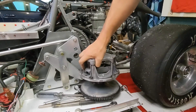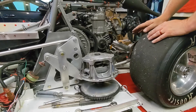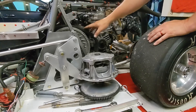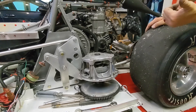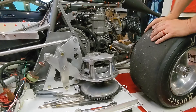So that's removing the primary. Removing the secondary is different on all cars — I'm going to leave mine on. You're just going to have to look at how your car is assembled; usually it's sliding the jackshaft out of the way and then the secondary comes out. I actually have another secondary I'm going to use for demonstration. We're going to move over to the workbench and I'll talk about breaking down the clutches and what to look for to make sure everything is operating and clean.